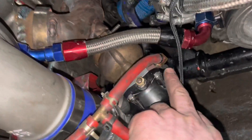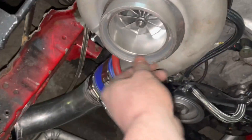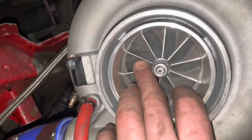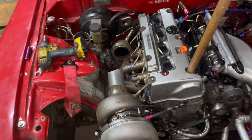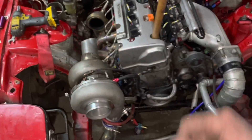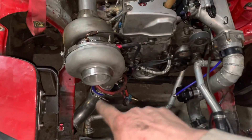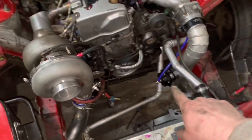Progress — I serviced the wastegate a little bit, and I also changed this to a 90 degree fitting so it was further away from this housing. Lots of stuff's been happening. Obviously that's bolted on now. I'm gonna have to get a longer silicone — I'll order one from eBay tonight. Check the size of that fucking angle. I need to ready to do the downpipe — I'm waiting for a V-band to come from the internet. The idea of this is I can completely swap out setups between the three turbos, and nothing has to be modified. The smaller ones have their own pipe and their own downpipe, and the rest should be pretty much bolt-on. I also put on a wee dump valve as well. Interesting to see how this goes.